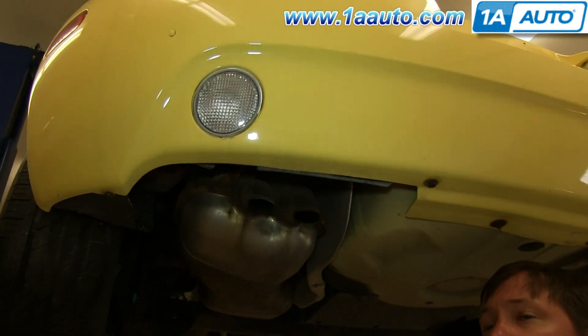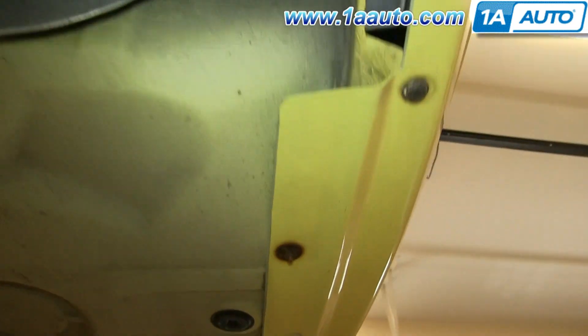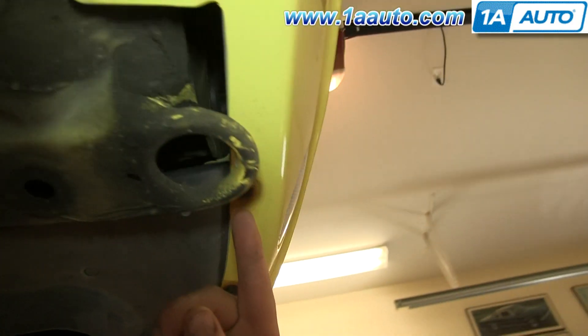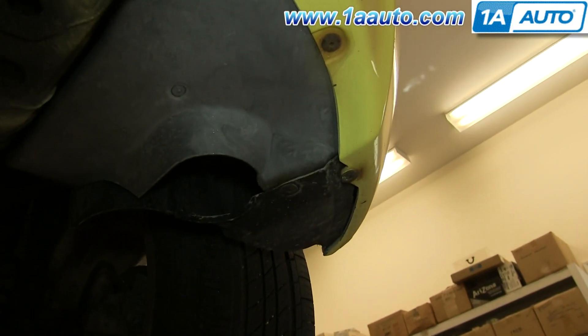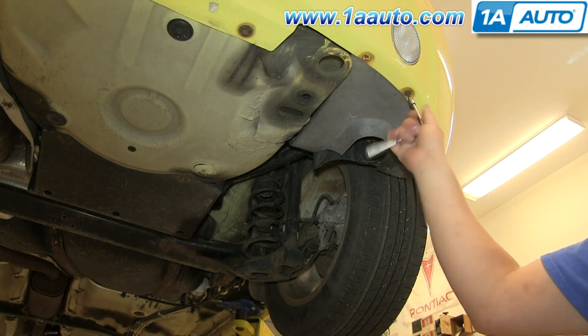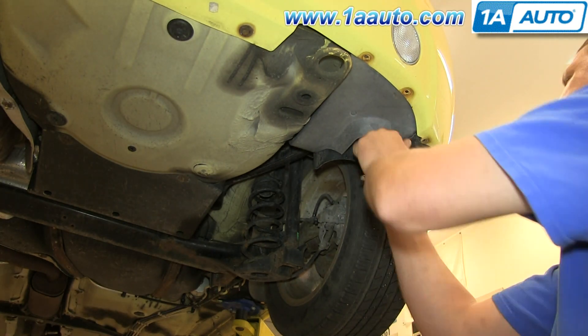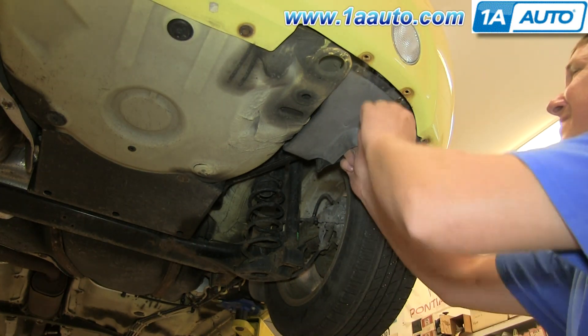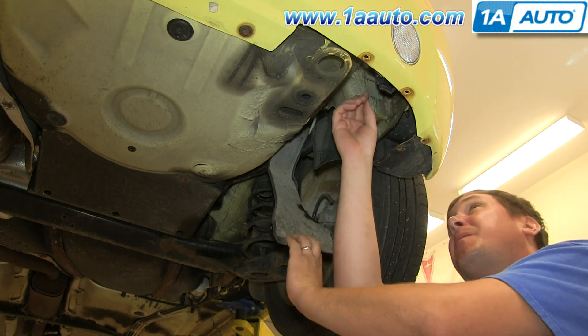On the driver's side, you can access the light right here. On the passenger side, there's a panel that's held in with four T20 Torx bolts. Just go ahead and remove those. Slide back the panel and pull it down. Now you have access to the back of your reverse light.